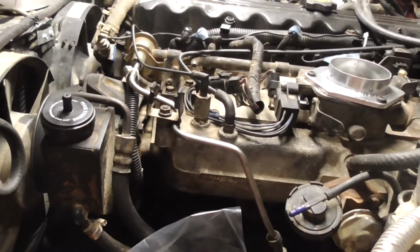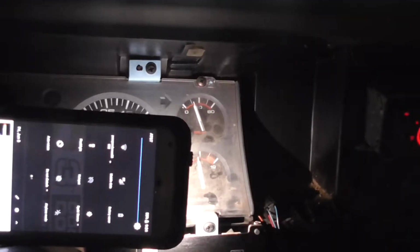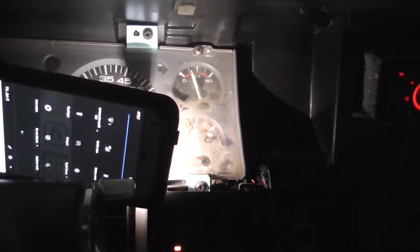I hate this. The dash lights don't like working on this. I hope the headlights still work. Yeah, it's going through a cherry bomb. I still have to get the front drive shaft, but yeah, the alternator's charging, even though you can't really tell because this, oh yeah, you can, right down there. These gauges are kind of like the old GM gauges, and some of the old GMT 400 gauges read low. I know my buddy's '95 does.